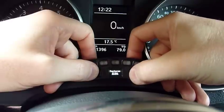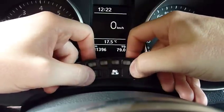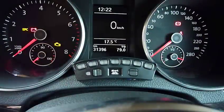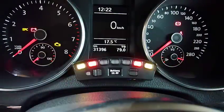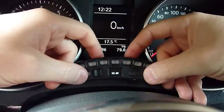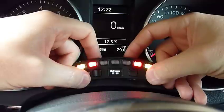Other features include staging, stall alert, cruise dimming, and voltage alert. For the voltage alert: we're currently at 12.4 volts. If it exceeds that amount, three seconds after it's going to issue a warning. You can cancel this if you want, and once it's cancelled it'll stay off. However, if you scroll through the situational screens, you'll see it's still active.